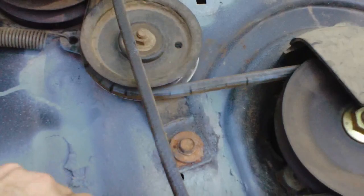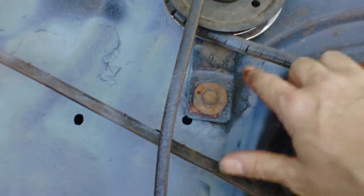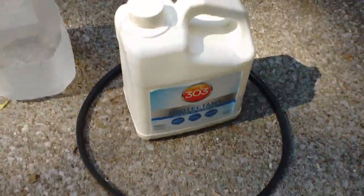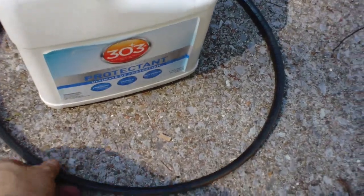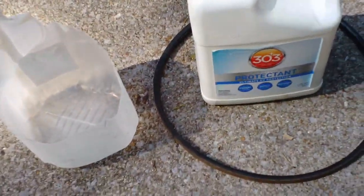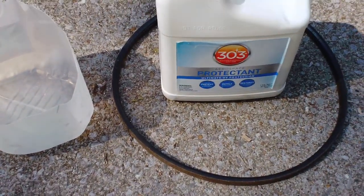Sometime when I get around to it I'm going to soak them. This guy was seized up and rusted up too, so put some grease down in that on the deck right there in between that. But yeah — even with worn out belts — I learned about this stuff last year and wish I'd known about it a lot sooner. You don't have to get the high-dollar stuff, but this is like armor on steroids. Even on a used belt or a brand new one, soak it in this stuff — put it in a container, roll it up. You have to get a bigger container for big long belts, but I'm a believer in this stuff. It helps the belts last longer and cuts down on squealing.